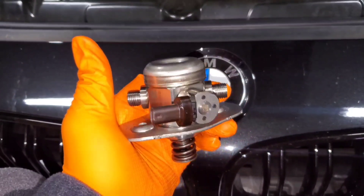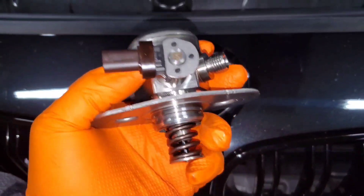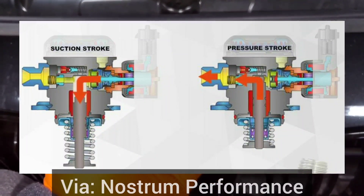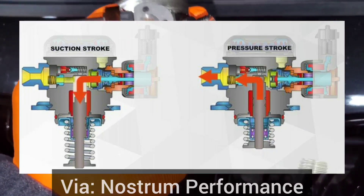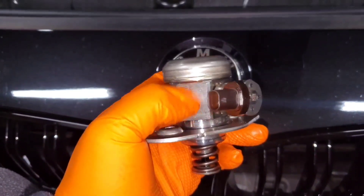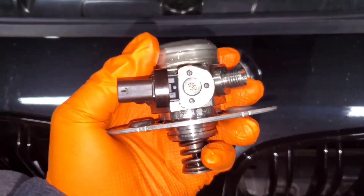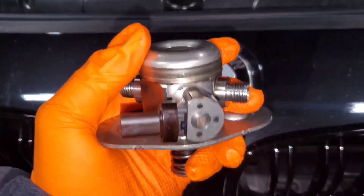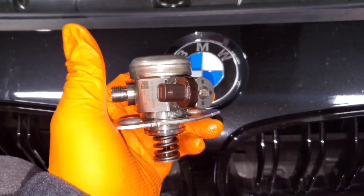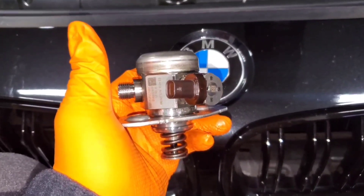It's really simple in design — it's a mechanical pump because you need a mechanical pump to create the pressures needed for a direct injection system. The actuator pumps mechanically to create fuel flow. If you want to increase the fuel flow, you can either increase the stroke of this actuator, make it longer, make it wider, or make the internal cavity wider so it can suck in and push out more fuel per stroke. You basically need a mechanical change to increase the capacity. This pump is good for around 450 wheel horsepower with the stock turbo, or probably upwards of 470 to 500 wheel with a bigger turbo — it kind of depends on the setup.